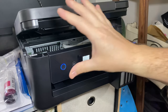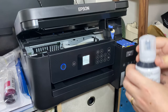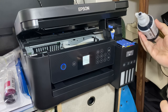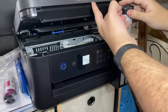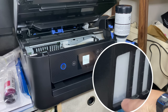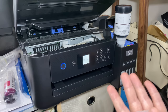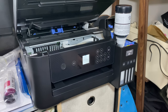Here you'll see my Epson printer is open and I am ready to fill the ink. I'm just following along with the instructions on the Epson app. Here we have the black ink, which we're supposed to fill first. I assume we just pop that there — it's got to be open a bit. I can hear that chugging away — check it out, that water line's filling up. Apparently this takes about 75 seconds to get up to the top fill line and then it's just going to automatically stop filling up. It seems like a really painless process, and we'll skip ahead to when it's filled.